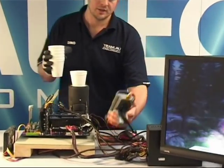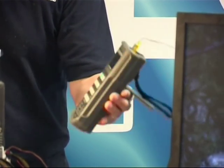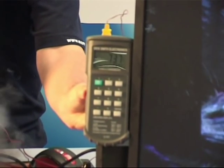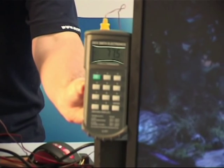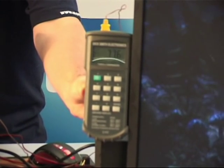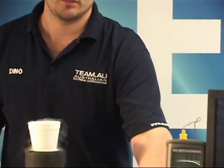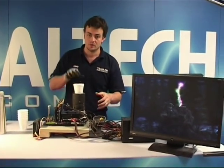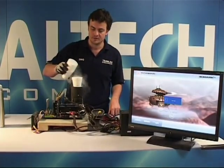Okay, so we're doing 3DMark06 at the moment, Futuremark, so you can have a look at the screen. And my temperature is basically varying between minus 73 and minus 78, roughly. And I'm basically just keeping it there for now. When I start to push the CPU more seriously, I'll have a much closer look at this, and I'll be concentrating on the temperature differential a lot more. So I'll be very careful where those temperature differences are.